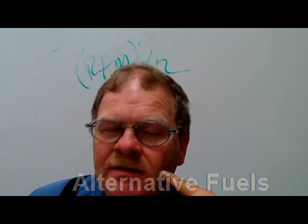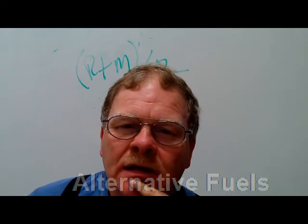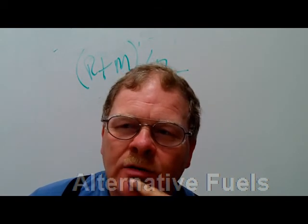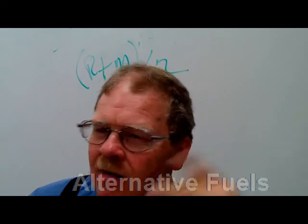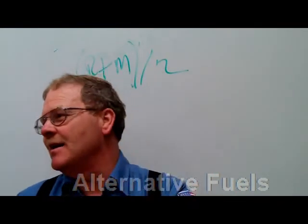All right, let me ask you this. What if I was going to take a car that was set up to run at sea level, and I was going to take it to a really high altitude and run it? What do I need to do with the timing? Obviously, I need to change the air-fuel mixture, because the air is thinner up there. What do I need to do to the timing? Advance it. Yeah, you've got less oxygen, you need more time to burn.